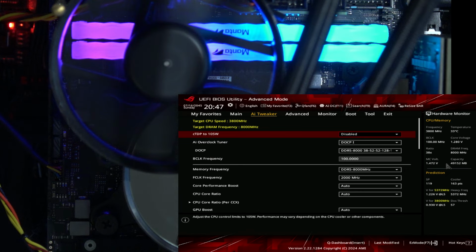There's potentially, obviously, the silicon lottery affecting the CPUs, right? That I have no doubt about. Though I was really hoping that at least with DDR5, because as far as I know, the PHY that AMD is using for Ryzen 9000 and 7000 series is a design that they licensed from Synopsys. And as far as I know, it's supposed to be designed for DDR5-8000.